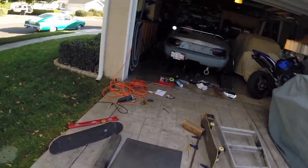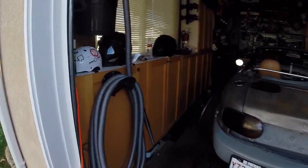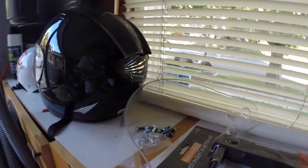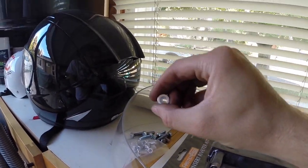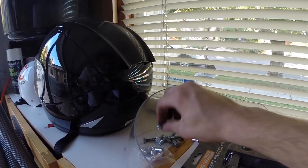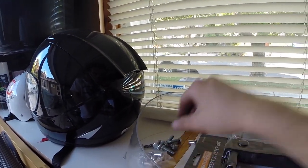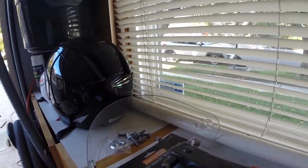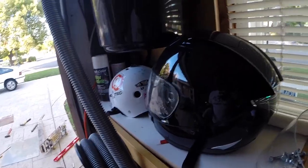What I'm gonna be doing is drilling holes in my subframe and then putting these rivet nut things in there, so I can just screw my skid plate right into the subframe. And then if I ever have to replace the bolts or the skid plate, it'll be pretty easy.